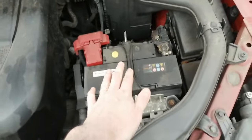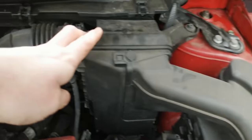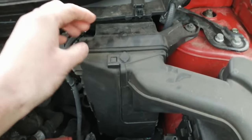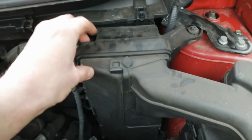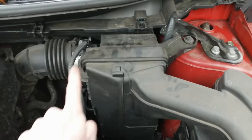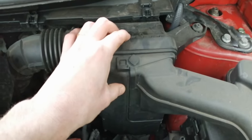The battery is just here. The airbox with the air filter is up here, and the feed pipe goes all the way around. A little tip: if you've got an unusual rattling from here, this isn't very well designed — the front part and rear part have no dampening between them. If you get a rattle especially on idle, it'll most likely be this. What I've done is run a piece of foam from a hobby shop around the outside of it — it's still sealed, not letting any rubbish in, but it's stopped that rattle really well.